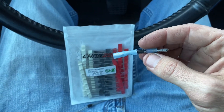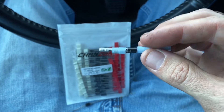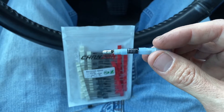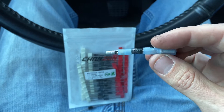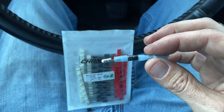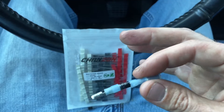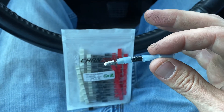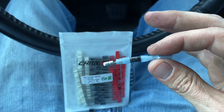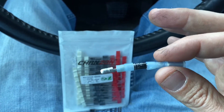If you're running lithium it'll probably be alright to run these all the time, but if you're running an AGM or regular lead battery I would not leave it in all the time. When it's cold outside my batteries have a lot more juice in them — the alternator puts out more — so when it's warm my car charges about 14 volts, but when it's cold it's putting out around 14.7 to 14.8, almost a full volt higher.